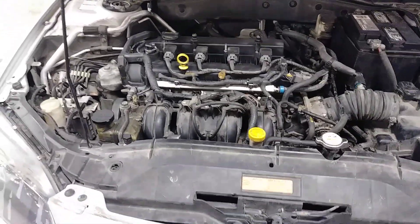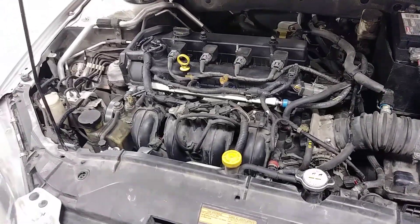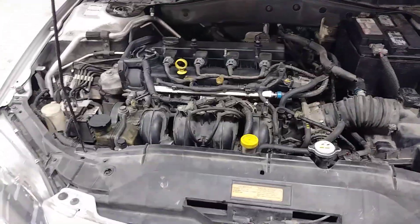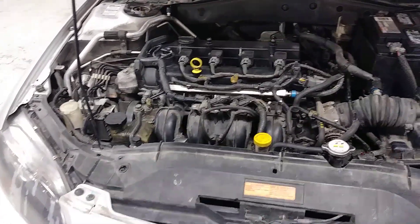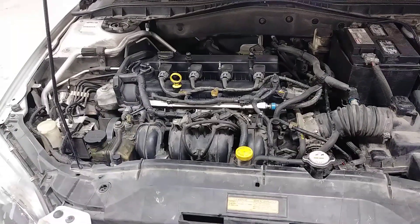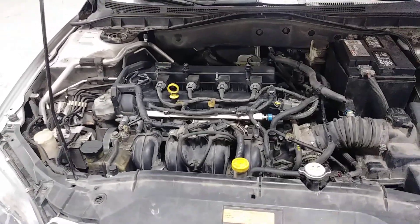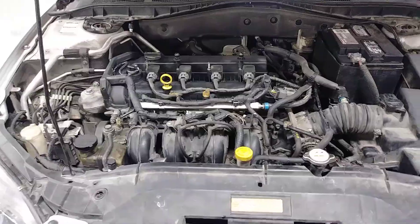I just drove it five miles, beating on it — zero to 60 and various things — checked that cruise control was working and looked for oil leaks underneath. Everything looks good. It ran so well that if I do another 2.5 swap, I'm going to do the adapter plate method. There are no modifications needed and it just attacks. I'd suggest buying one of those adapter plates on eBay and doing the stock 2.3 intake — it really runs great just as it is.